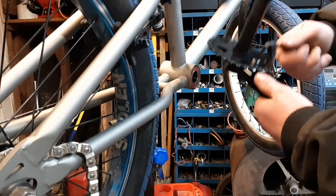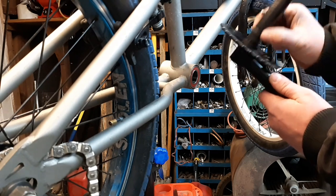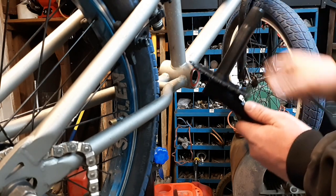Make sure this bolt is tight. Got your spacers behind your sprocket — for me it's just one spacer. There's the adapter — don't forget the adapter. Then the spacer. We're going to put some grease on the shaft.